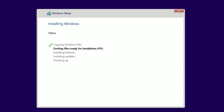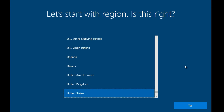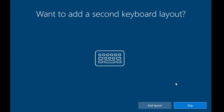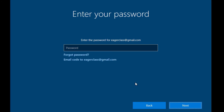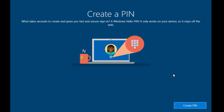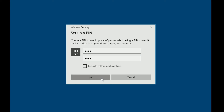The Windows installation will now take place. Sit back — this will take around 20 minutes to complete, so be patient. After several restarts, Windows is installed. Continue the setup: select your region and say Yes, select the keyboard layout and skip if not needed. Now create a new account — enter your email, click Next, and log in with your Microsoft account. Then create a security PIN.